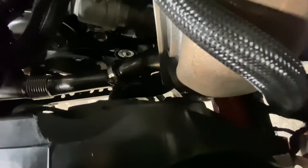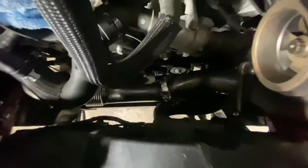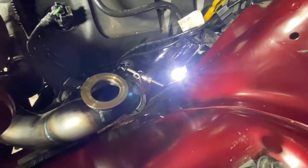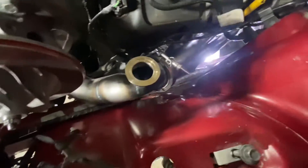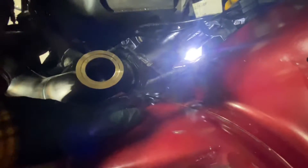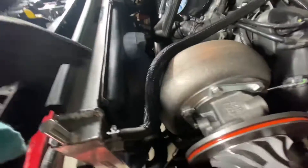Look at the clearance there — it's just mocked up right now, still loose. Over on the header side, you can fit the header right through the top. I just had to adjust my brake lines a little bit, but for the most part it's pretty much dead nuts. I did massage the body a little bit for more clearance, but honestly I didn't even have to. The turbo right there is not hitting — plenty of space.